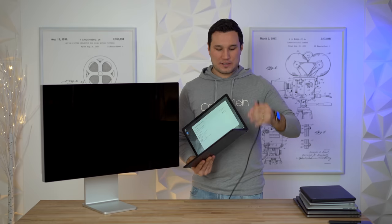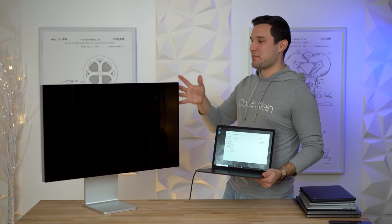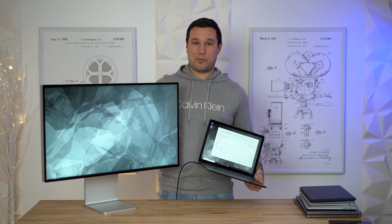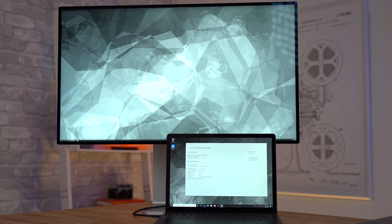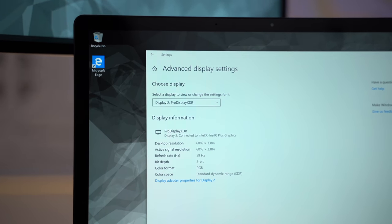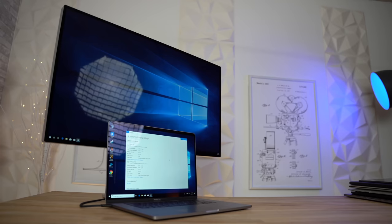Let's try the Microsoft Surface Laptop 3, which also has 10th-gen Intel CPU and graphics — but notably, it does NOT have Thunderbolt 3, only USB-C. I was shocked: not only does it identify the display and automatically show up, it is running in 6K — even without Thunderbolt 3. This is a Thunderbolt 3 monitor as Apple markets it, just like my LG 5K; but my LG 5K cannot use USB-C and needs Thunderbolt 3, whereas this Surface works. It is running in 8-bit, not 10-bit, and I don't get an HDR option. Running 6K at 8-bit gives you 16 million colors versus 5K at 10-bit HDR which gives 1 billion shades — so it can't do that option, but it works, which is really surprising.